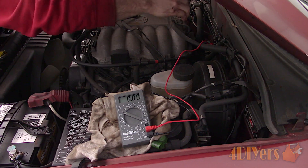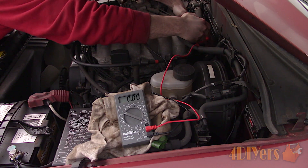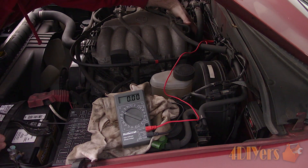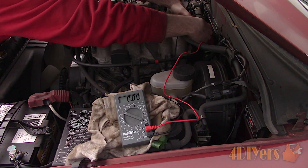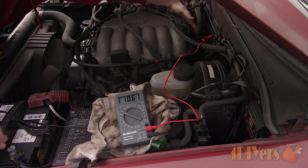For testing the wire with the multimeter, keeping the connector disconnected from the sensor — it uses a spade connection and this may be hard to access with a probe, so I installed another spade connector and probed it from that side where it gets crimped. With the key in the on position again, probe the connection. The positive probe is on the wire for the sensor and the negative can be on the battery terminal. Battery voltage should be present here. If not, there is an issue with the wiring or connector.